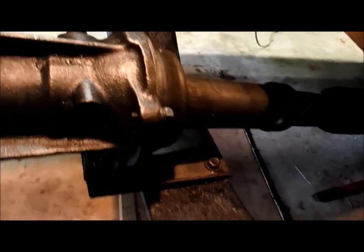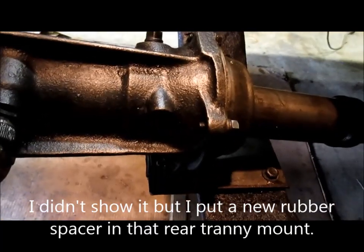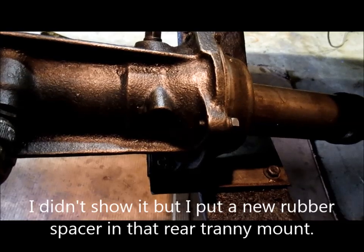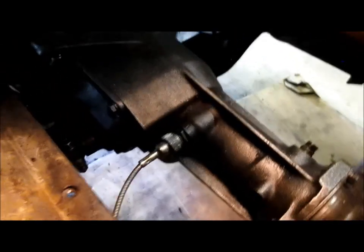Going inside, the transmission is connected. There's the ball collar, and remember I did the adjustment outside the truck, and to tell you the truth, it would have been a real pain to have done it underneath. And all the linkages, the clutch, good strong clutch, got about an inch play there, and the book calls for 3/4 inch to an inch, so we're looking good there.